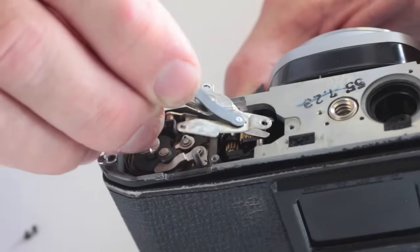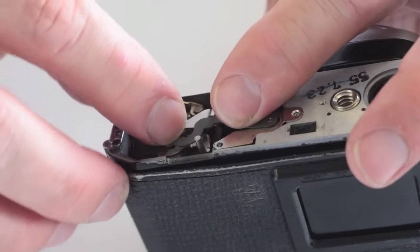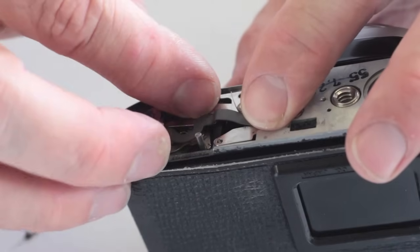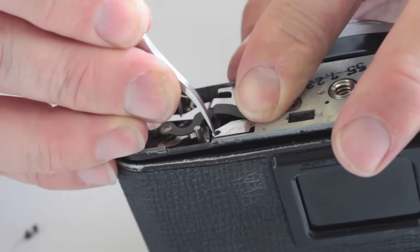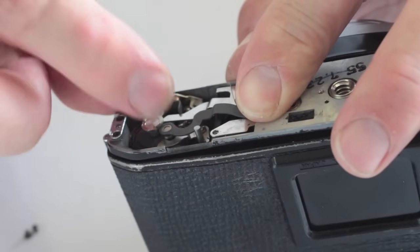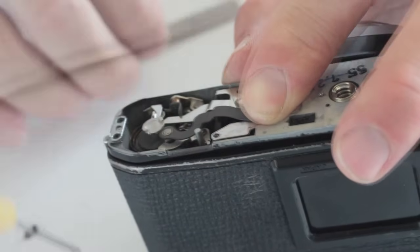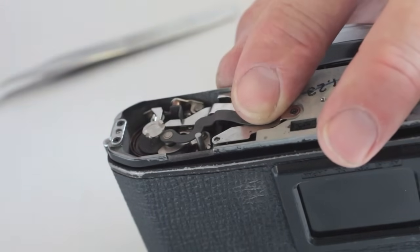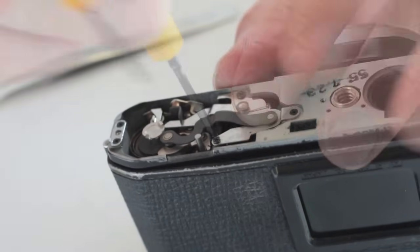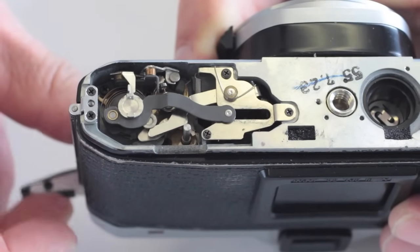Feeding the levers of the lower wind mechanism into the proper timing can be tricky and might take several attempts to get it seated so it winds properly. With the mechanism slid into position, it should be held in place while the motor drive coupling is tightened back up. Install the shouldered screw, then the countersunk screw, and finally the standard screw. Make sure the cocking levers move in tandem and in the proper sequence.